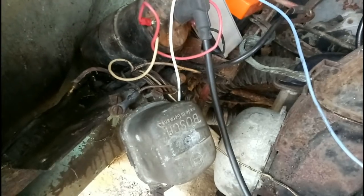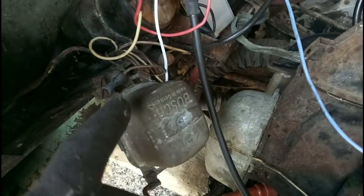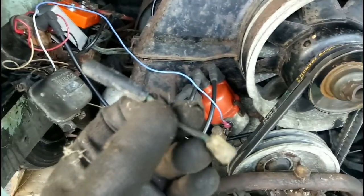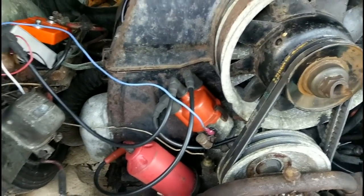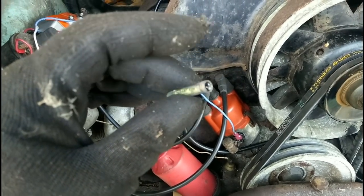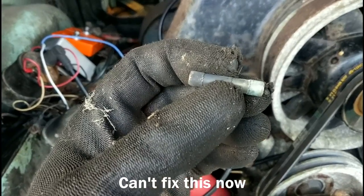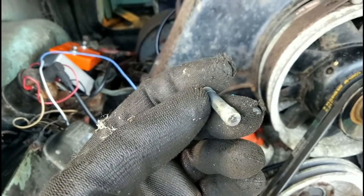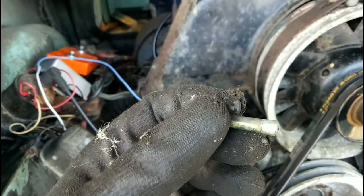The orange light hasn't gone out. I've unbolted the voltage regulator. I believe that's working correctly but there was a wire connected here which has come apart while I've been tinkering. And furthermore, this 50-amp fuse seems to have blown in spectacular style. That is a very dead fuse. I don't think I have any 50-amp fuses - that's quite big. I'll have to see what I've got.